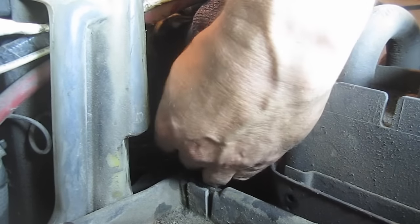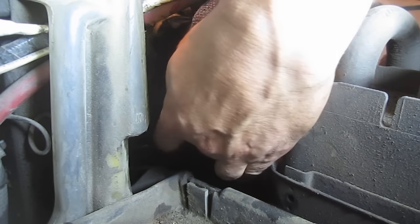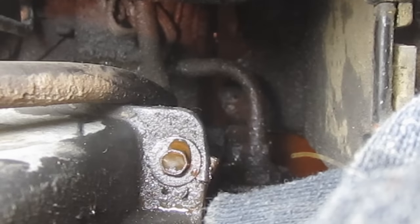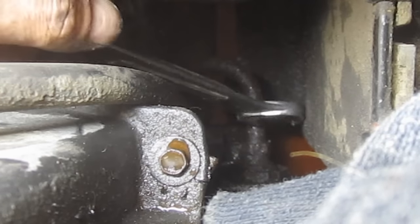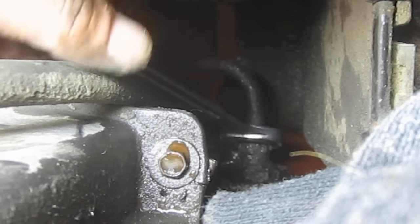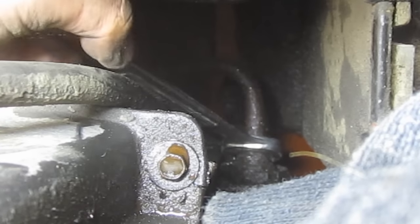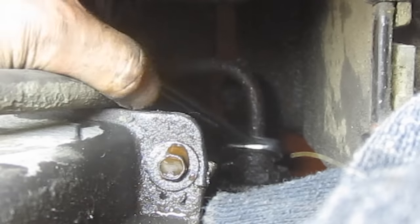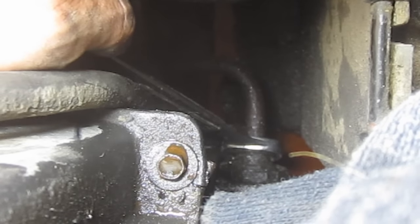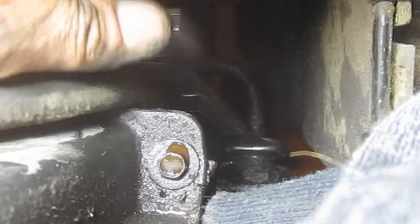I think it just went — and we may see a little bit of oil here. After further examination, I've decided I'm just going to go ahead and try to put the wrench on the lower one. I can actually get more of a straight-on shot from down here without removing anything. I've hit that with PB Blaster and I'm hoping it's going to be enough — just going to apply steady pressure. If I feel like it's going to strip, I'll stop. Going slow, and it just went.